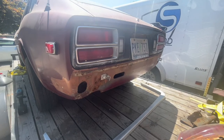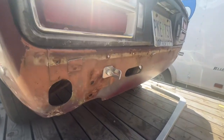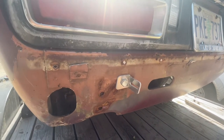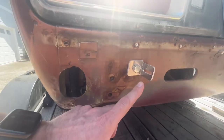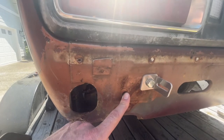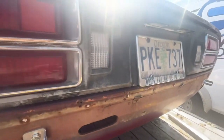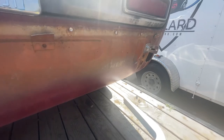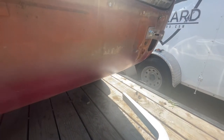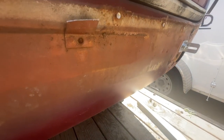Here we are at the back of the 280z parts car. I've already put on the two brackets that go on the car — you can see this one here. This is a '78 280z and you have the factory bumper mounting bolt here; we utilize that hole. On a '74 to '76 this side looks the same. On the '77 through '78 it has an additional mounting point right below it, but we're just using the mounting points that are actually the same on the '74, '75, '76, '77, and '78.